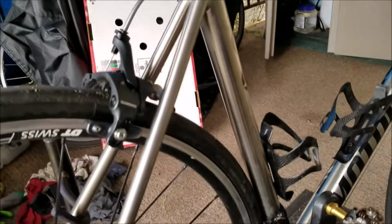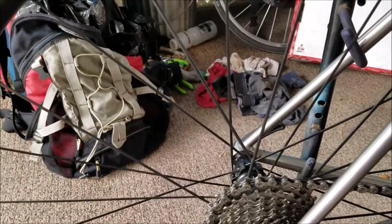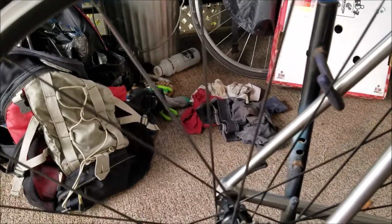Okay, this is the third video on this Motobecane Le Champ I bought August 22nd, 2019. So it's a little over a year old now, and I'm estimating about 8,000 miles on it. Now I had to change the chain. I think the chain lasted me about 6,000 and was out to 1%. Probably ran a little longer than they recommend.